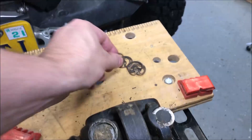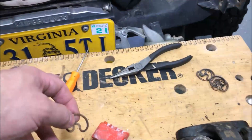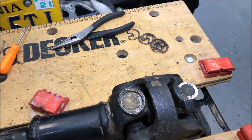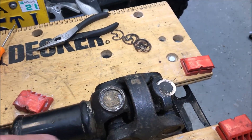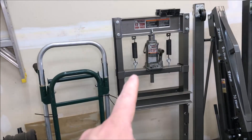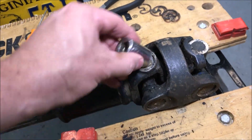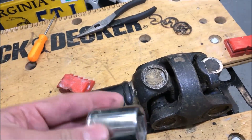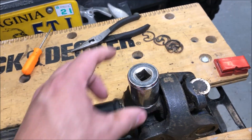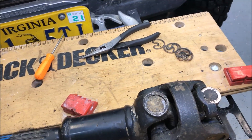I've got all the clips out — they're not that hard. You may want to spray them; they get a lot of junk and get a little crudded up. Use needle-nose pliers to get those out. The next trick is pressing the u-joints out. There are a bunch of ways to do this; I happen to have a press. A three-quarter-inch socket fits in there, and a one and one-sixteenth socket goes over the top on the bottom to press them in, with pliers to pull the caps.